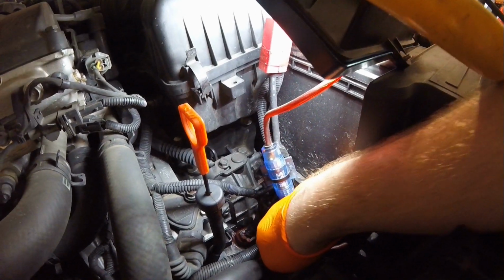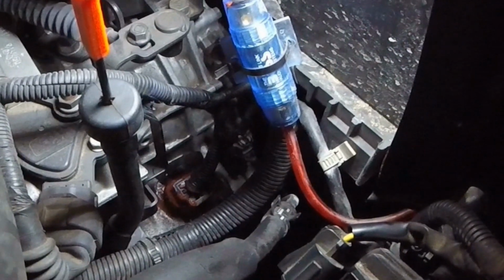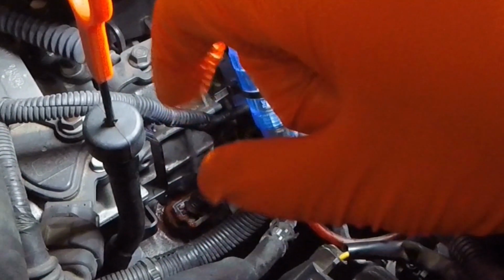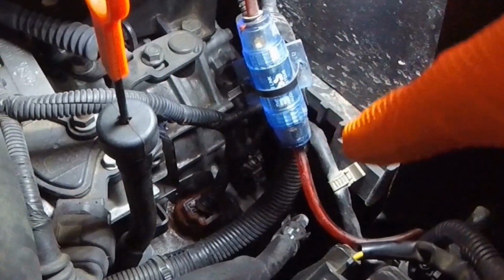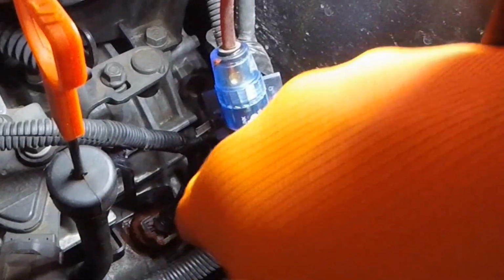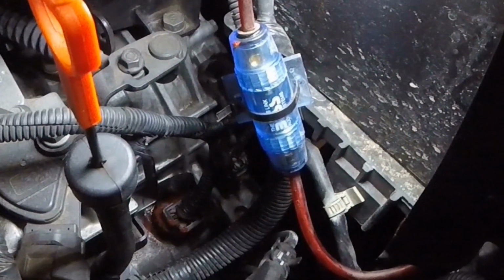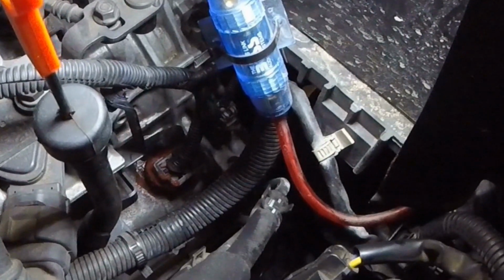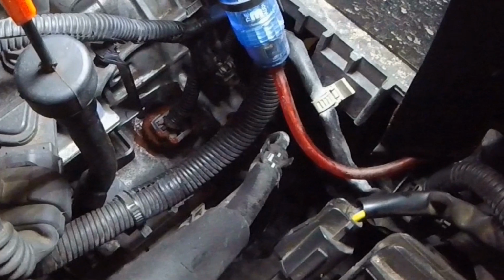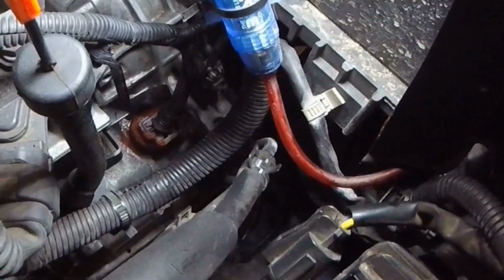The connector has a gray tab on the bottom half of the screen. It's kind of hard to see from this angle. Most connectors, you think you squeeze them side to side, but this one you actually press down. So you have to use a screwdriver and press downwards towards the ground on that clip, and that will eject it upwards. I ended up breaking mine, and you can see there's some red silicone adhesive up there. I just kind of doused it with high temp silicone to try and hold the connector in place.